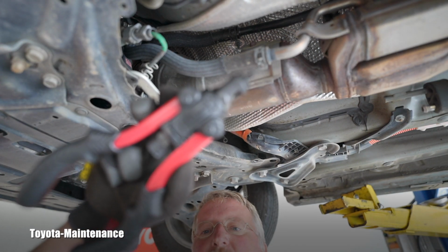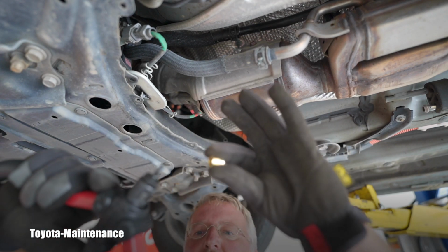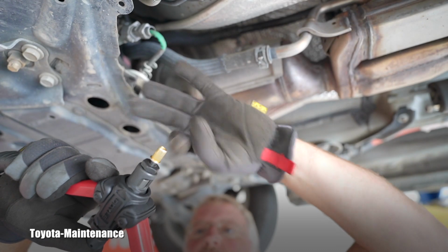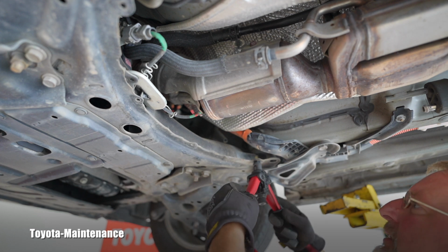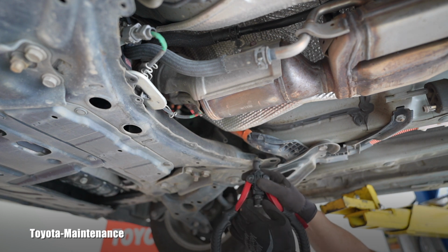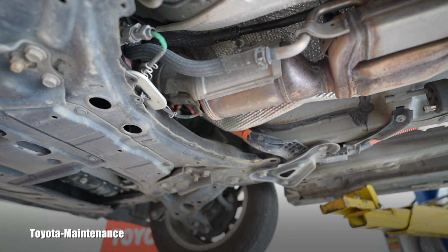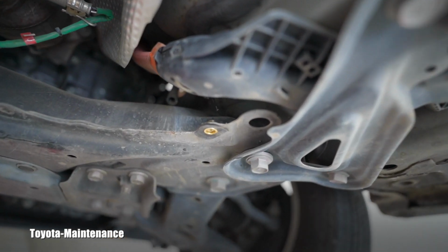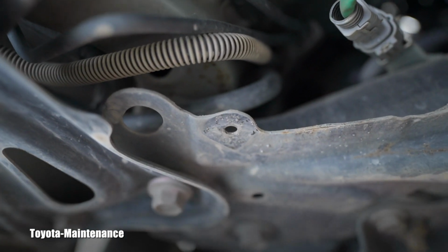For that you will use this special tool. You can hopefully see it. There is an M6 thread on the top and you just screw it on in the open position. You insert it in this opening and you carefully, slowly close it all the way. Now I unscrew it right here and that rivet nut is perfectly installed. Let me give you a close-up. So here you go, that nice little gold beauty, and I will continue without you on these additional three.